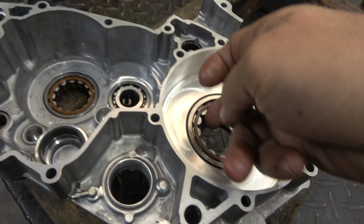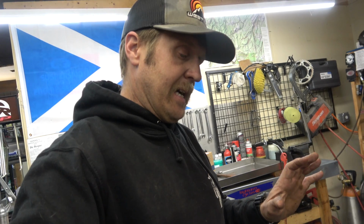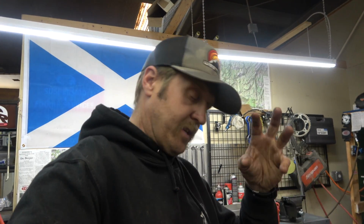Very happy about that. So now, here is one thing, guys. It's only till tomorrow, hopefully, that I have to wait before the crank shows up. But even though it's only a day, that's going to warm up really fast. It's going to soak the heat into that metal, but it's going to create some condensation, because it's sitting in the freezer, coming out here, it's going to get air on it, condense some water, and what we want to do is make sure that it doesn't rust at all, not even a tiny bit, before tomorrow. So I'm going to grab some spray grease that I have, spray that all down to make sure it stays nice and lubed up and doesn't rust.